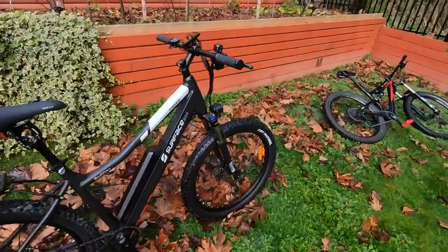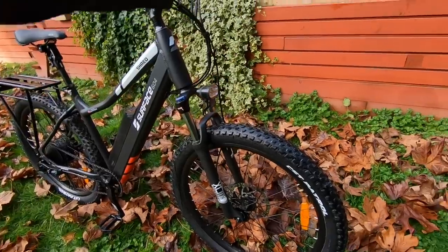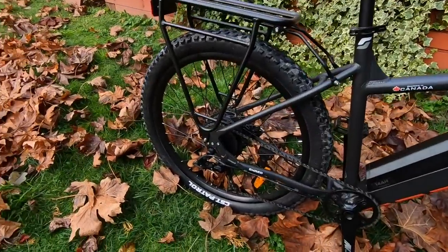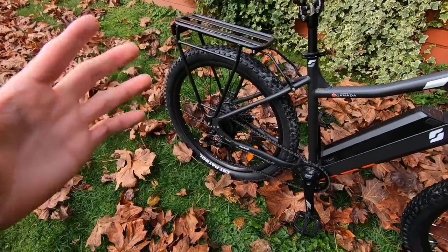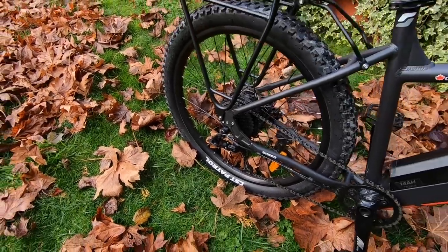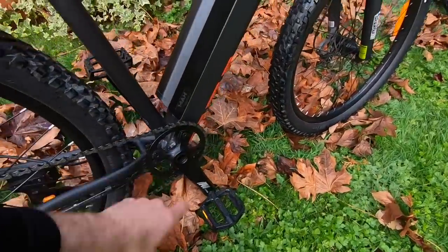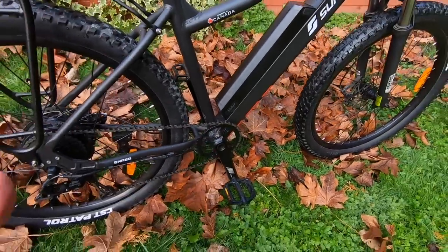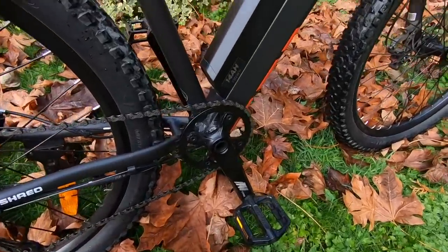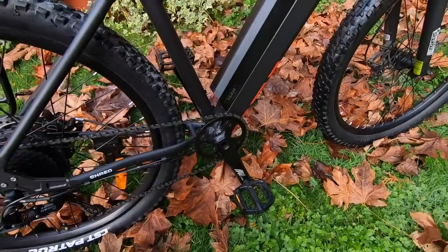It's pre-wired for adding a rear light — right now there's just the reflector that comes standard with the rack. Up front there's an awesome integrated Shendo 60 light with two LEDs and a nice beam that angles downward and lights your path well. Back to the hub spacing: 100 millimeters up front, 135 in the rear — not boost, not even 142 — but that probably helps keep the price down with more traditional parts. It runs an SRAM X5 derailleur, 9-speed with 11 to 34-tooth sprockets and a 38-tooth steel chainring up front.